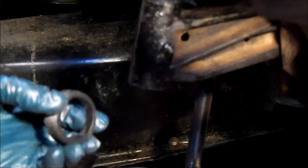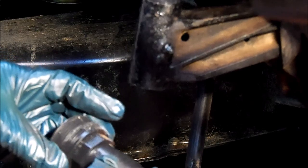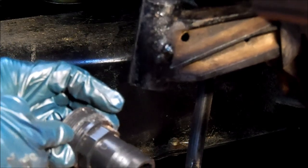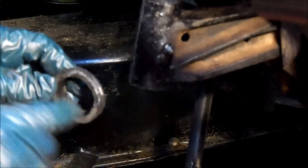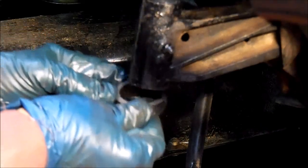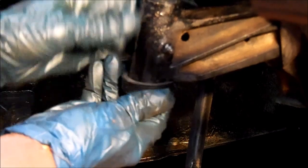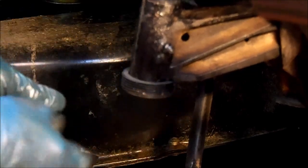I took this plumbing fitting and put it on my bandsaw, and it just happened four threads down — I cut it in two. Then I measured the width of this front axle and notched it out like this. What that does is it comes up and comes around this axle and indexes right there, and it cannot turn when that kingpin is back up there. You'll see that this fits nicely around that bearing to protect it.